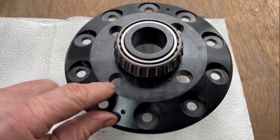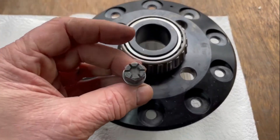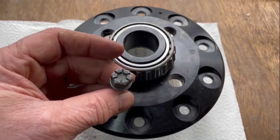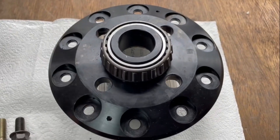That creates even more damage and probably wrecks a diff. Bear in mind that these holes here are for oil to get in, not broken bits of crown wheel bolts. So for all our diffs, we never ever reuse any bolts at all and we always upgrade - so we get rid of that.